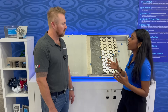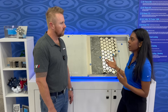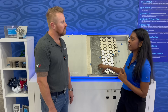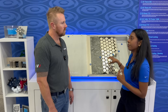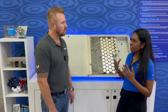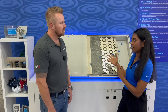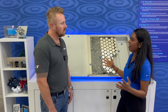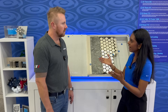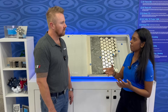Apart from fire protection, there are several other benefits for the EV Protect foam family. One is structural performance. There are some customers who use this material not so much because they care about propagation performance — they do care about that — but without our foam they actually don't pass vibration testing. It really helps unitize the system. Also, for packs in really hot or really cold environments, the foam surrounding everything helps maintain a somewhat constant temperature, acting as an insulator — so there's less of an issue with range loss in winter.